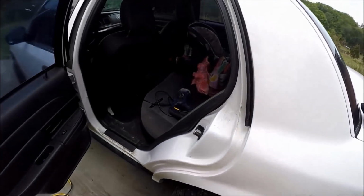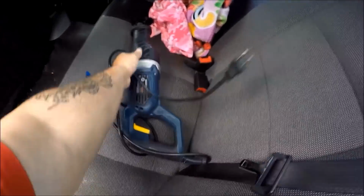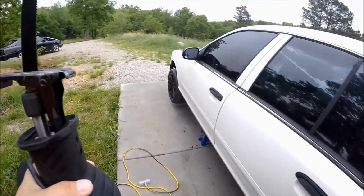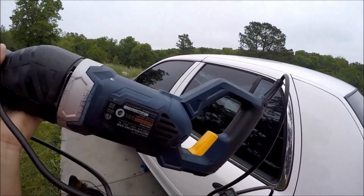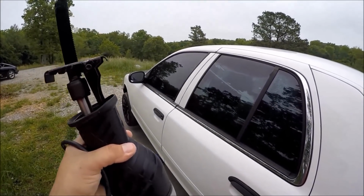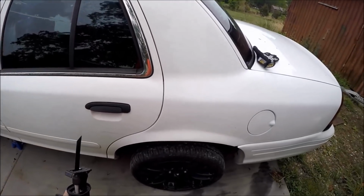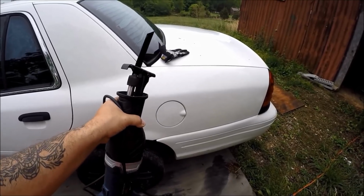And the tools of the trade. What you're going to want to use for any muffler cutting, we have our Harbor Freight, like $20-$30 reciprocating saw. You can get yourself an entire exhaust system. It's going to sound so badass for the price that it costs. This is what we're going to be using to cut our last rear cats. And then the whole muffler system is going to drop, and we're going to cut off the last two supports on the right and on the left side.